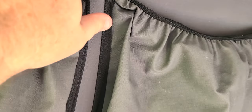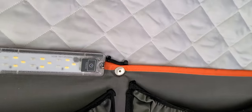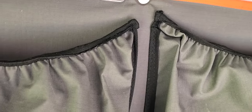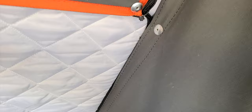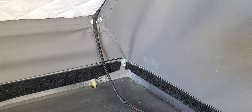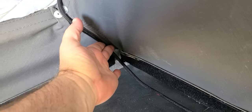The threshold light is up. I ran a loomed, reinforced wire at larger gauge — I think 16-gauge, fully shielded. Zip ties hold the loom. It runs back behind the pocket and comes out in the corner. There's really no way to clip or secure without drilling into support rails, so I just tucked it in the corner. Down at the bottom I want to put a little bracket bolted to the metal with a loop screw to close it off, but it's all loomed and runs underneath through the supports nicely.